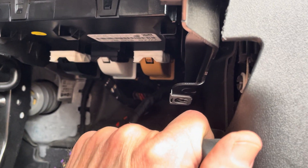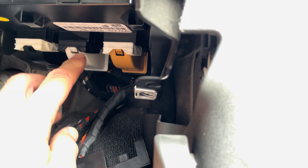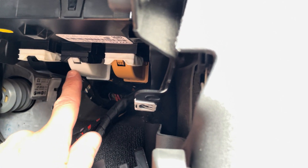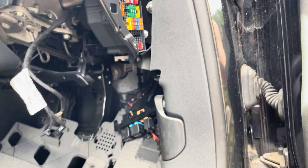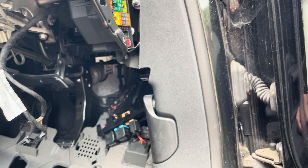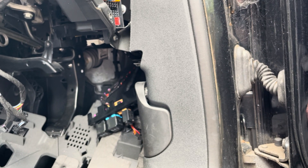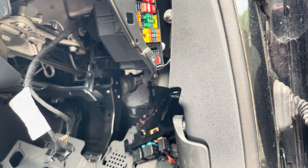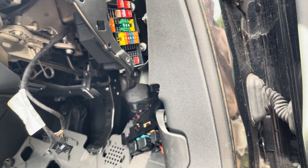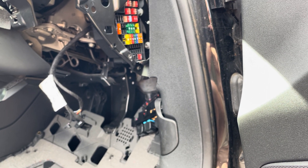With all three BCM plugs out I put all the fuses back in — front and rear — and had low current, just a very small amount. But as soon as I put in the middle plug, the current shot up. This middle plug had the connections to the alarm module. Having seen online that people have problems with the alarm module, I went there next, and that turned out to be the fix. I'll put notes in the description about the various currents at different stages. If you've got a battery drain, I would suspect the alarm module — get it out, disconnect it, and see if your problem goes away.